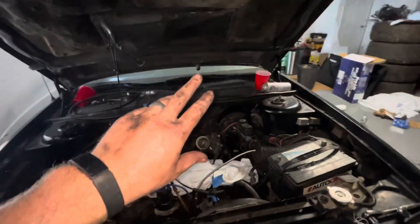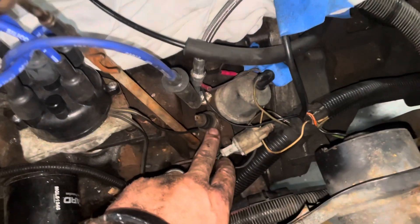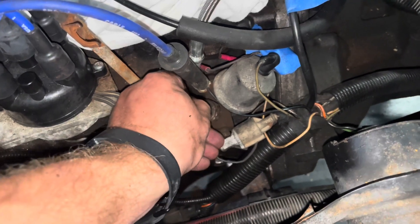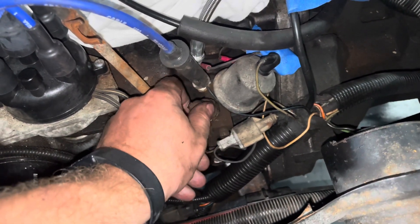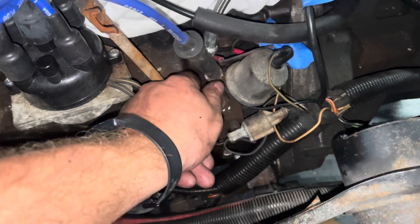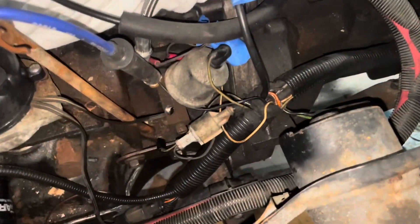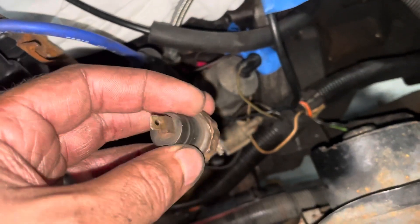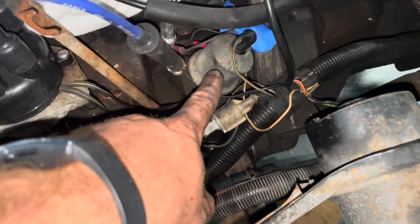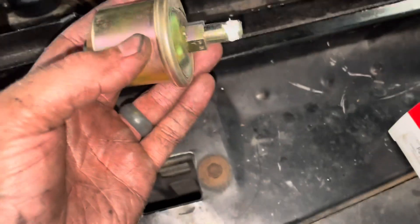This car's always had a funky issue where the oil pressure gauge just isn't right — it does all kinds of weird stuff. I got both sensors: one is for the low-pressure warning light, which I don't have issues with, but the replacement sensor I got for that one was the wrong thread pitch. So I'll reseal and reuse that one. The other sensor is for the gauge — that's the one we're having issues with. I have a new oil pressure gauge sensor and hopefully the threads are correct on it.